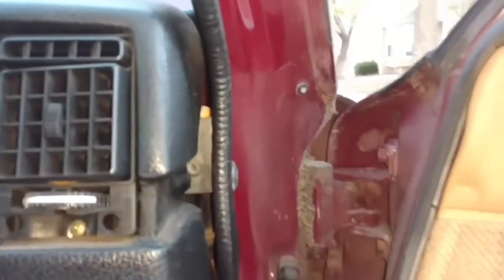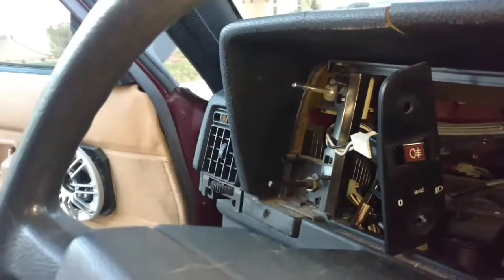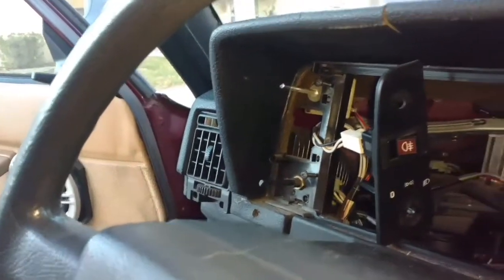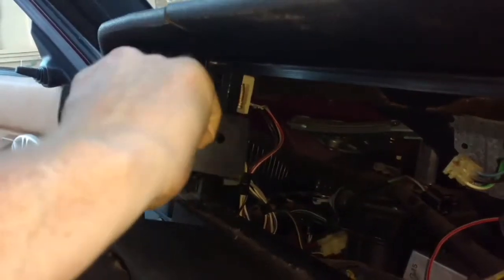Take a piece forward — you have easy access to a screw there, and a screw under here. Get it loose from the driver's side with a bone tool. Then we need to disconnect the fog light switch from this trim. Just unplug it.